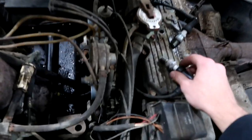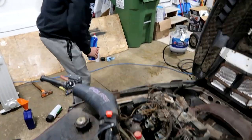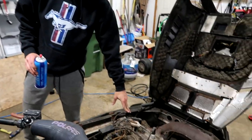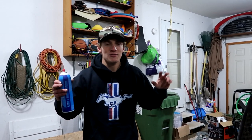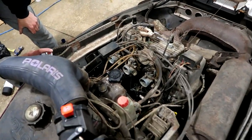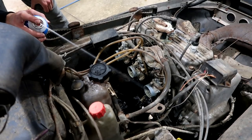We got spark on all three. We're going to throw them back in and spray some starter fluid down the carbs and fire her up. We got the good old carb clean — this is where we pray she fires up. We don't want to use too much of this stuff because it doesn't have oil mixed with it. One thing we did before throwing the spark plugs back in is I used a little engine oil and put it down the cylinders, just because it's been sitting a while and we don't want to score our cylinder walls if there's any rust in there.